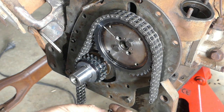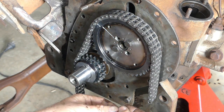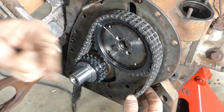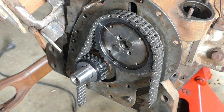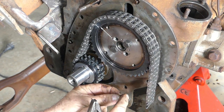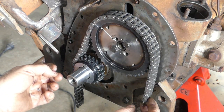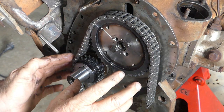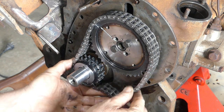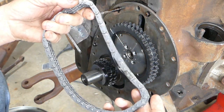This is a duplex chain. What I'm going to do is take the chain off and put the split link in. The tractor engine goes this way, so I'm going to have it so that the little clip — the natural motion of the engine forces that on. I'll pop that off, take the chain off, put the joiner in, and try to bring it all in together as a unit already assembled rather than get the pin in separately.